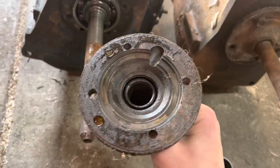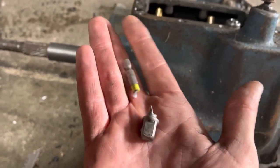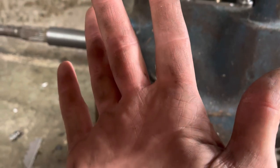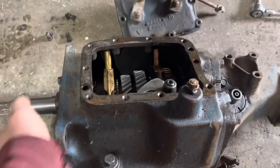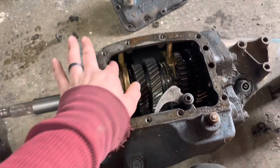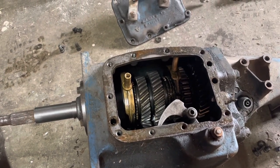Half the bolts and a quarter of the gasket are missing. There was a casualty — my Ryobi 3/8 adapter for my impact. You served me well, for like two and a half months, under light use. I noticed two side plate bolts were missing, so I was just going to rob them off the other transmission. But at the last moment I decided I should pull the plate and look — which I hate doing, it's a pain, all the linkage falls apart. But I'm glad I did. There's no gasket here at all. Off to get silicone.